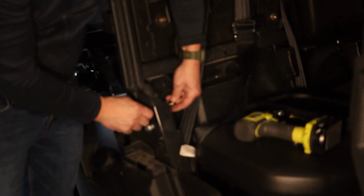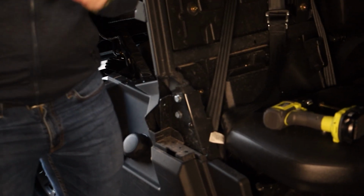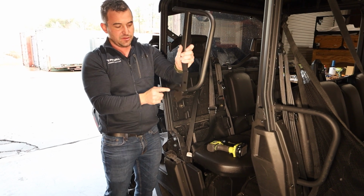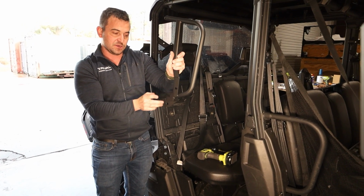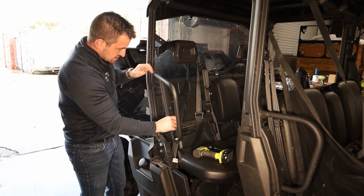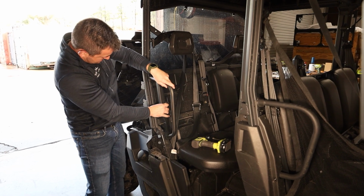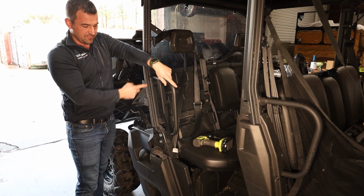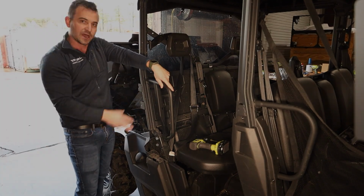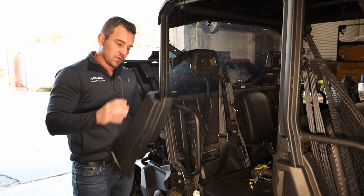Okay, and then just sit the nut on here gently, and then we're going to slide this bracket on, because see how this here is opened up. We're going to slide that on so that the spacers are on this side facing outwards away from the bike. Then we're going to take our 6x35 and put it through here, and that then replicates the shoulder guard.